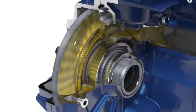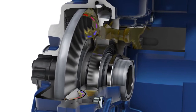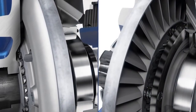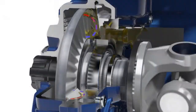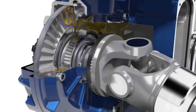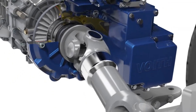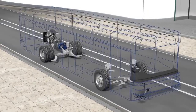The rotor is connected with the vehicle prop shaft. Through its rotary motion, it accelerates the oil, builds up braking torque and is pulled into braking position via a helical gear. The rigid stator redirects the oil and moves it back to the rotor. As a result, the rotor, and therefore the prop shaft, are decelerated — retarded. The vehicle is decelerated.